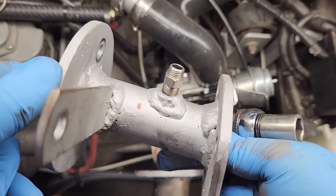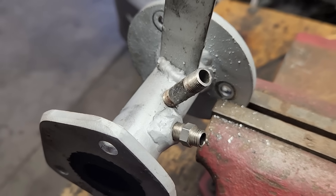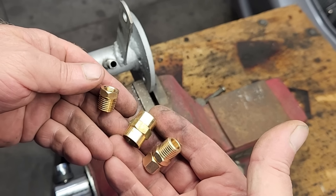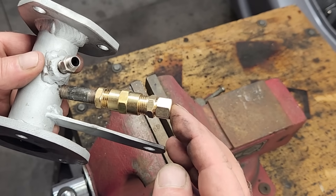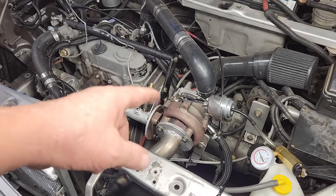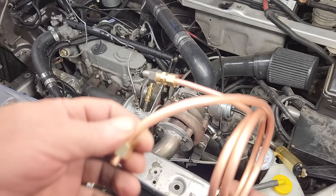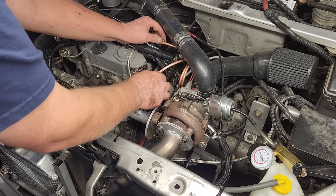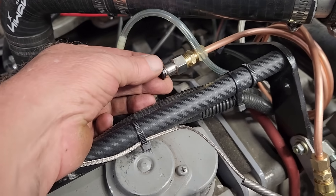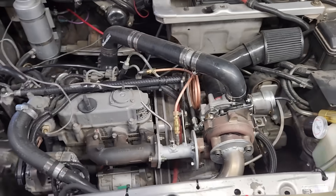We finally got the extension pipe removed — let's go ahead and drill and tap it for the exhaust back pressure gauge. Fast forward a few minutes and I've tapped the hole to accept a 1/8th inch NPT nipple. I have a bunch more NPT stuff to convert the 1/8th inch to 1/4 inch, and then we can use a compression fitting to connect the quarter inch copper pipe. Through the magic of video editing, the car is back together. The stack of fittings have been tightened — it's not pretty, but it'll definitely work. Now we can attach the 3-foot section of copper pipe. The copper's high thermal conductivity will allow it to transfer all the heat to the air, and the end of this pipe should stay relatively cool — cool enough for what we need it to do. On this end of the pipe, I have a quick release fitting that'll allow us to connect a high-pressure flexible nylon tube, and that tube will connect to the pressure gauge.